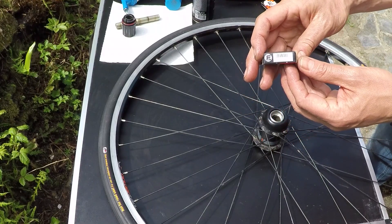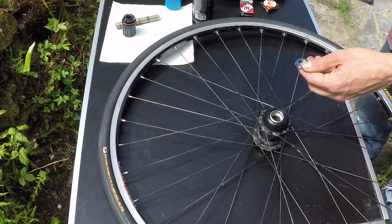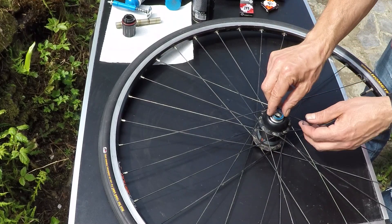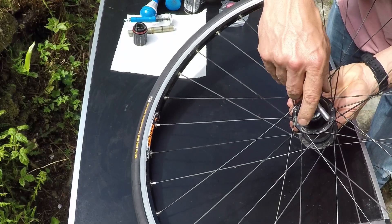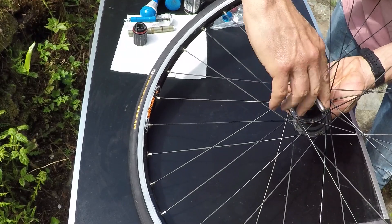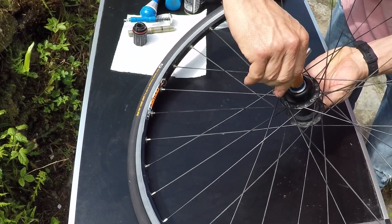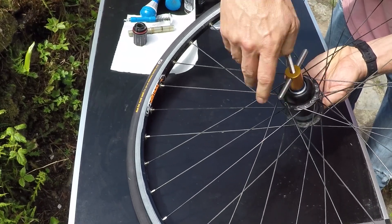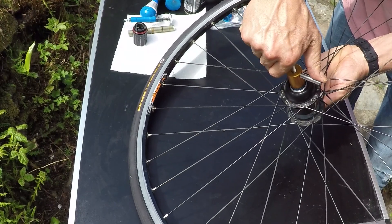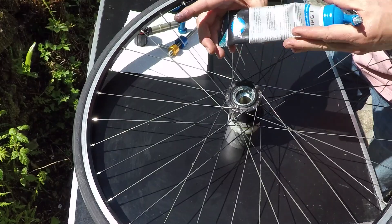To install new bearings start with the non-drive side, which is a smaller 6802 bearing. I'm again using the RRP tool, this time with their number 9 kit. I'd recommend using a tool like this rather than tapping with a punch — it also makes the process much quicker. Grease the bearing inside and out. The RRP kit comes with two short lengths of threaded rod, but you'll need something a little longer — it's standard M8 8mm studding that you can buy very cheaply in 1m length and cut to size. Position the bearing and slide the blue adapter into the bearing and the other half of the adapter inside the other side of the hub. Carefully press the bearing in just until you feel it stop. Lightly grease the ratchet inside the hub — it's easy to do this now. Not too much grease since the pawls of the free hub body need to be free to move.